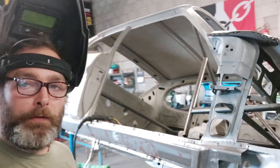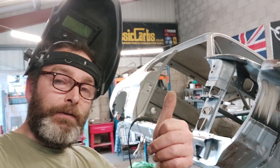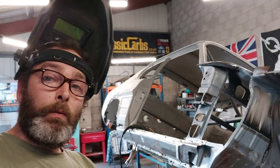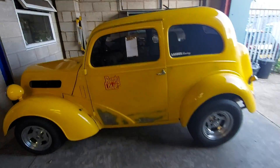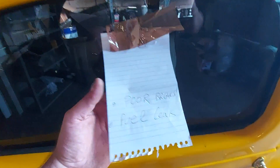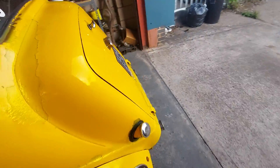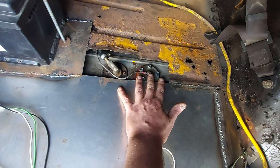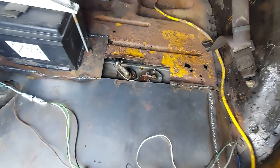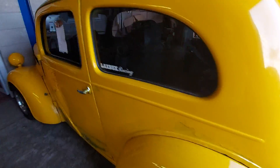That's just a shorty update on the 69 Capri — thank you for watching and being interested. The pot car: I took it home last night and on the way back this morning the brakes faded, so I've put a note for Tony saying poor brakes. We've also got a fuel leak on the tank, which is a bit of a fire hazard. It's this fuel sender unit here — we've tried gaskets and rubber seals and everything, and it's still leaking, right next to the battery.